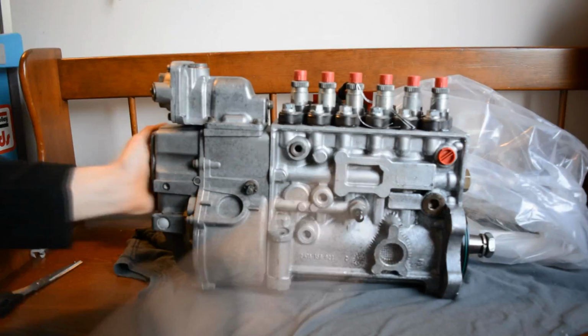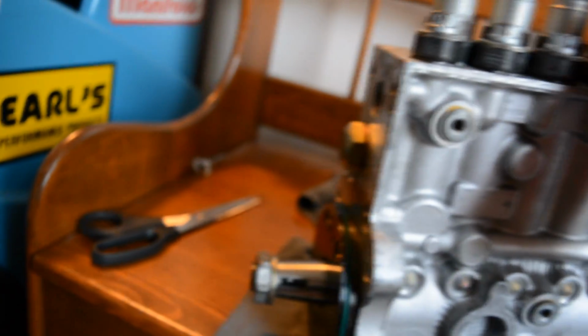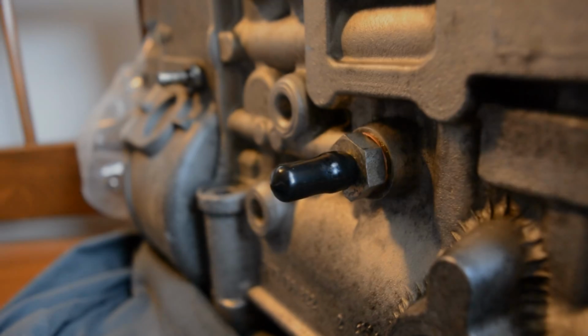So this here is my rebuilt P7100 that I got from Seth Farrell of Farrell Diesel Service. It's got 035 delivery valves, 100 plate modified AFC, so it's got 50 PSI full rack travel. It's got 360cc fuel set at 40 PSI, 0 PSI boost is 100cc's of fuel. And it's considered a stage 3 pump.